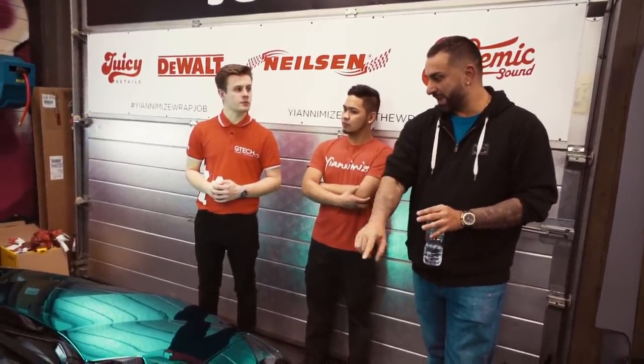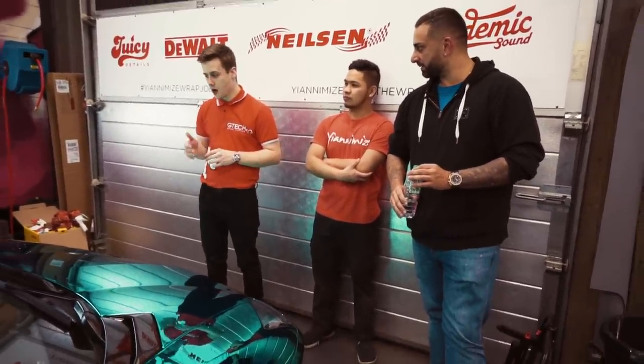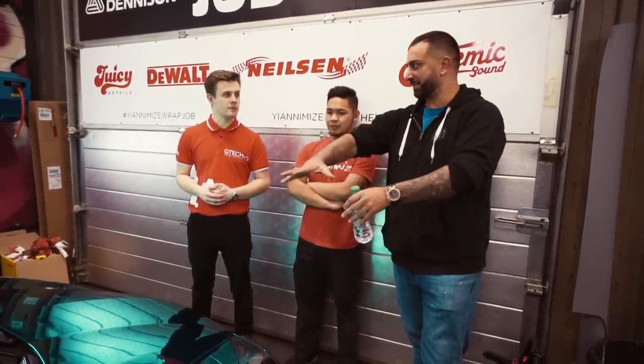So this is designed and formulated purely for PPF and vinyl. Let me ask you a question — if this was a matte coloured car and you'd done the bonnet, would the wing and the bonnet look a slightly different colour? No, exactly the same. That was one of the key things during the early development stages — we need to enhance the visuals of gloss film but under no circumstances shall it gloss up satin and matte. There's a reason they've gone for that finish in the first place. The reason I ask is that someone might miss a section or get tired partway through, and you don't want the front to look shined up while the rear looks dull. That doesn't happen with this — no it doesn't.